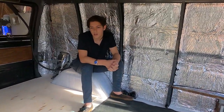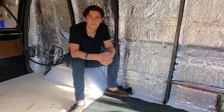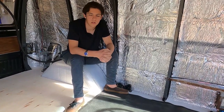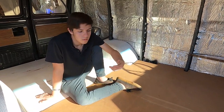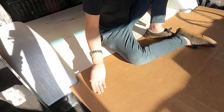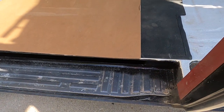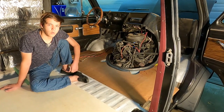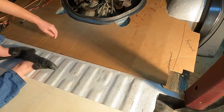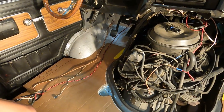It's a 4x8 sheet, and it turns out a lot of people don't know this, but when you're buying wood from a place like Home Depot there is a piece of cardboard at the bottom of the plywood stack — it's to make sure it doesn't get damaged during transport, and Home Depot doesn't mind if you take it when you're buying all the plywood. Now we've got the template made. We have a quarter inch gap around the entire perimeter and over here we have a half inch overhang to roll the carpet over and create a hidden edge. It was pretty complicated to make, but it appears that the floor is flat from here forward, which would be nice for thermal and acoustic insulation from the additional plywood.